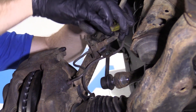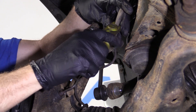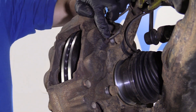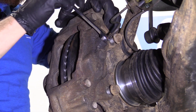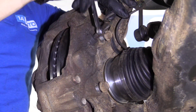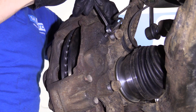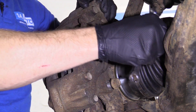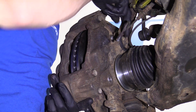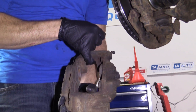Now that we have the line nice and loose, I'm just going to bring it back to the snugged point where it's not leaking out. We're going to take off these, hang this again. We're going to grab our new caliper and new pads, put them on here, and then we'll put the line in. We're going to pinch off our flex hose using some hose clamp pliers — these are gentle on the flex hose but they'll stop the fluid from running out. Now that we have that on there, we're going to re-loosen this. There will be some fluid that comes out, so make sure you're wearing eye protection, hand protection, and have a collection bucket to collect your fluid. Get this line off of here and set it aside. We're going to remove our bolts again. There's our left front caliper.